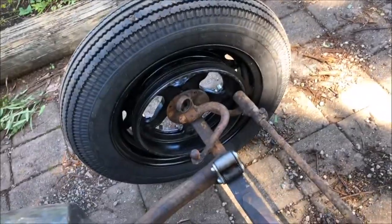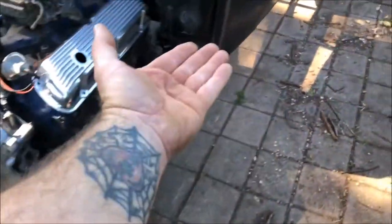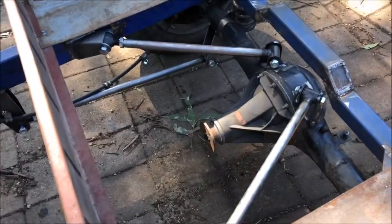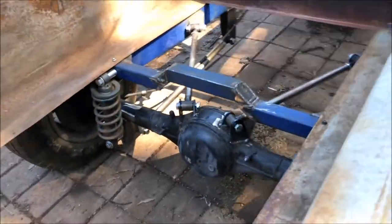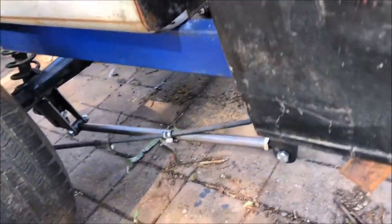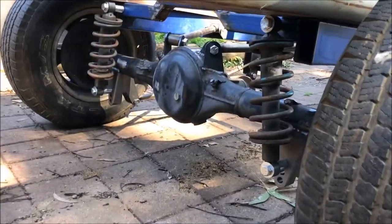It's not going to have front brakes. It's not going to run a radiator — well, not there anyway. I'm going to shoot some pipes underneath, and the pickup bed is going to be where my radiator sits. Thermo fan, just keep it clean at the front. I sorted myself out with a neat triangulated 4-bar rear end and a nice strong diff — a pumpkin diff, keeping that old school. Some old school coilovers, just to keep it clean and tidy.